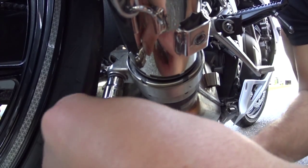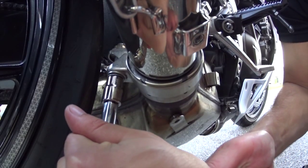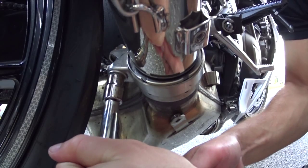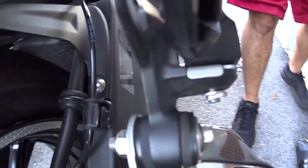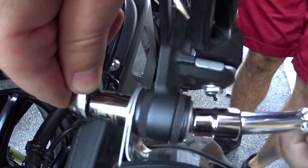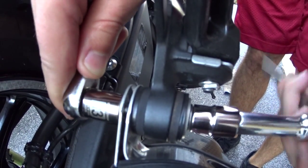There's really only about 5 or 6 things you actually need to take off to get the catalytic converter off the bike. For this particular piece, you're going to use a 10mm socket to loosen the clamps for the mid-pipe. After that, you're going to use a 10mm and 13mm to remove the exhaust pipe. And don't worry guys, I will have all this down in the description so you can reference it if you're doing it on your own Ninja.